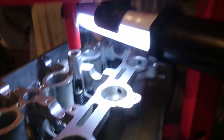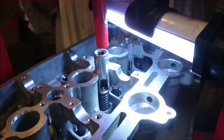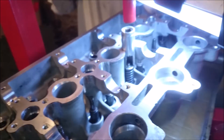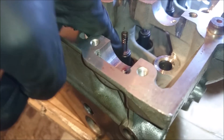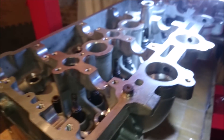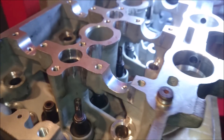Nice little magnetic light — thank you very much, eBay. Best buy I've had in months, that is — 15 quid, it's awesome. Another little trick I have to know: you get a little bit of grease on the end of your screwdriver, and that holds the collet on the end of the screwdriver — then you can flick it in. I've put the valves in — slipped them in with a little bit of oil, because you can hurt those seals putting the valves in. Valve stem seals go in, and they go in with a nice ping when you knock them in.